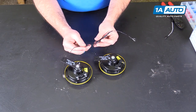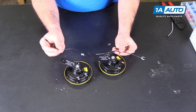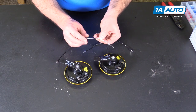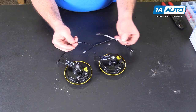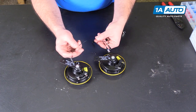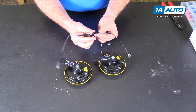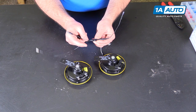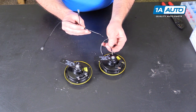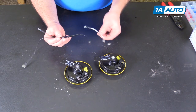We've adapted and made some harnesses. We're going to use these to ground the two horns together, and then we may need a little extender for the positive on one side, just because the factory wiring is a little short. We simply took some spade terminals, crimped them on some 18-gauge automotive wiring, and used a little butt splice connector — put the two wires in there, a little heat shrink and some electrical tape to make a connection to the ground, and then just an open terminal to put under a bolt.